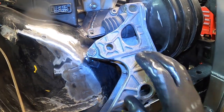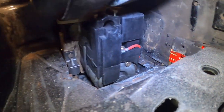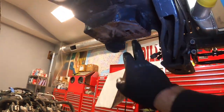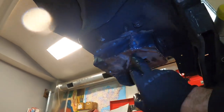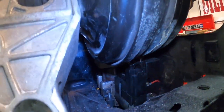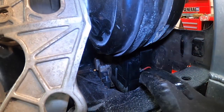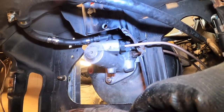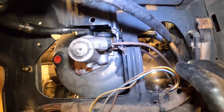The second thing we did was modify and install the ABS unit. We made a little tray for the ABS to sit down inside of the battery pack area. The brake lines are very conveniently located there — they come down and out over the side and up into the master cylinder, which needs to be cleaned. So the brake lines have now been plumbed and installed and they are sitting really nice.